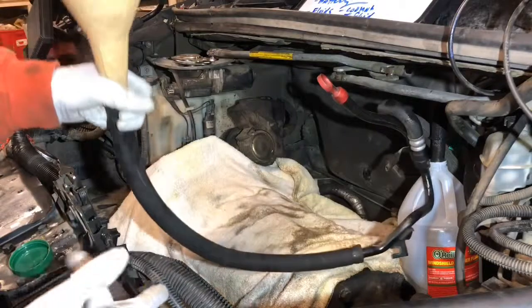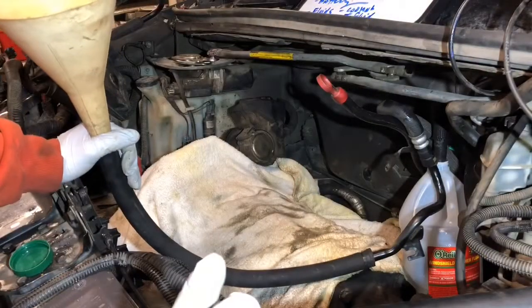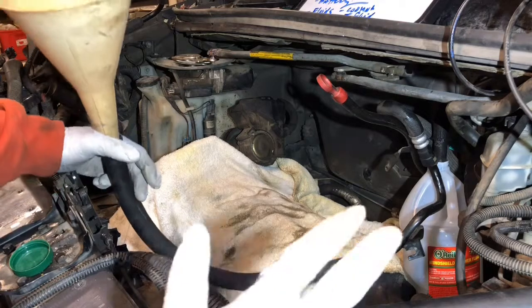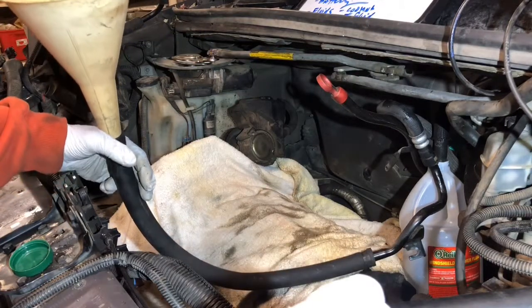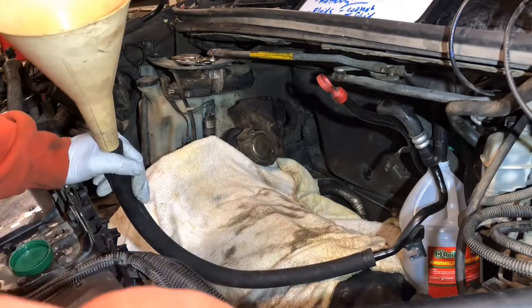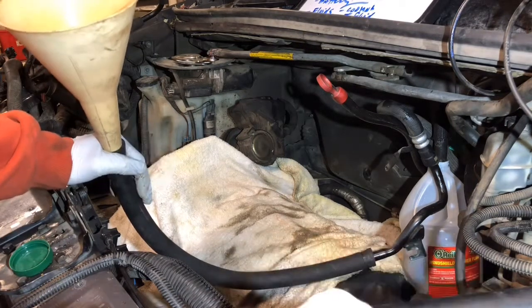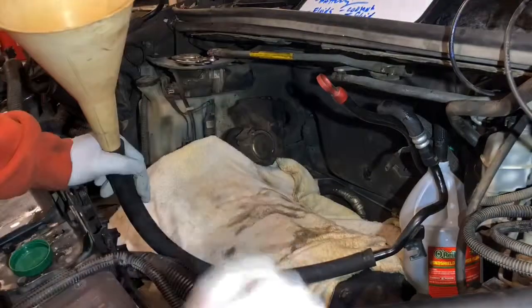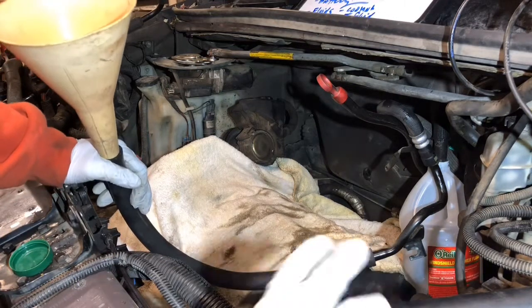So obviously you got the flush, you got the power of the air pushing the water through, and then of course, just doing it by gravity, if you don't have air, will at least help you clean out some of that bad coolant and hopefully any debris. If your heater core actually does have enough buildup to get clogged, the best thing to do is replace it. Not that you'd want to do that, because it's a pain in the butt to get to in most cases. But the next thing you can do is make sure that everything else is running great, but get some Prestone coolant flush. You add it in before you do a flush. What that's going to do is run through your system, really scrub everything, and hopefully help break up some of the debris. Then you go through and do a thorough flush. And if you still have issues, you might just have to replace the heater core.